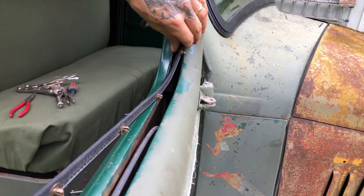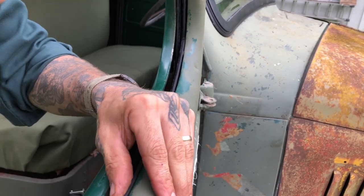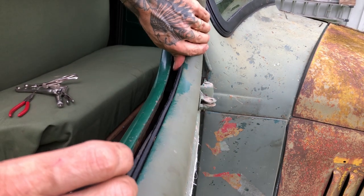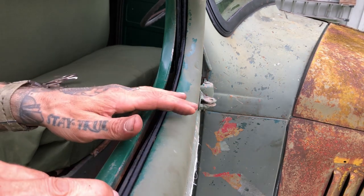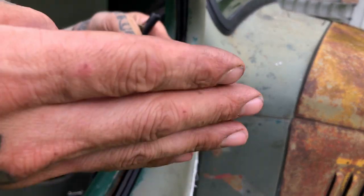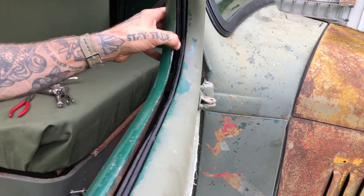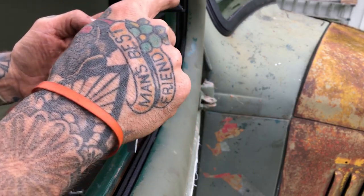Sometimes you can just adjust them with a screwdriver leveraging on them, but I want to make sure this one's perfect, so I'm going to clamp this end with vice grips and straighten out the other end with another vice grips. That kind of straightens it right out. Whenever you take these things back out of the holes, it helps to open up the little teeth again — they compress a little bit and you want them to be springy to catch those holes. On this particular door, the window glass is sitting right here, making it almost impossible to get the inner felt in. With a K-series window carrier you'd roll it down into the keyholes, but being a D-series window it would just fall right off the carrier. Sometimes these felts are just a little long and run interference with the window channel — just grip them lightly in a vise and trim the ends with a cutoff wheel.